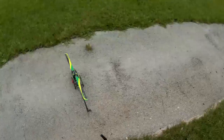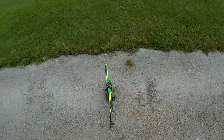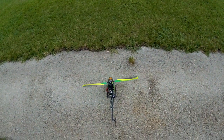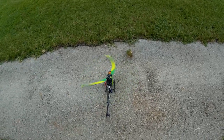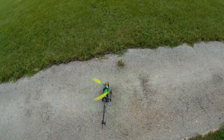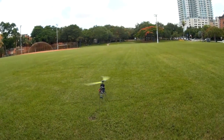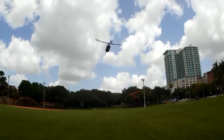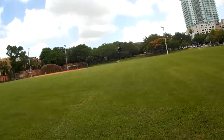I'm starting off on just plain mode zero, like I had it yesterday. And let's see how it starts off. And of course, it goes to thunder right on time when I come outside. Now we've got a higher RPM, a higher throttle at 50%. So my throttle to pitch ratio is a little higher — it should scream a little more, but it should be a little more responsive as well.